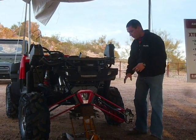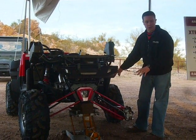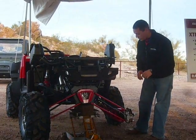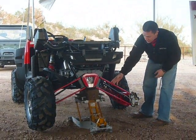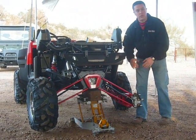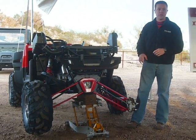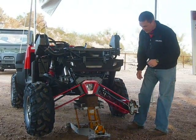First, on the strength, we got all our forces in tension and compression. As you're driving, the trailing arm takes all the forces going forward. We got 3/4-inch radius rods back here that handle all the lateral load side to side as you're going through the corners. We've got spherical bearings at all the joints. No bushings that are going to be wearing out.